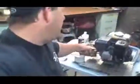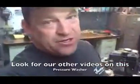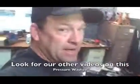Alright, so there you have it. We did a tune-up. We changed the oil on the water pump. We changed the oil on the pressure washer. Changed the spark plug. We cleaned out the throttle body and cleaned out the linkage. That's all there is to it. This took about an hour to do. Good preventive maintenance. I definitely recommend if you use a pressure washer, you do this at least minimum once a year, depending on how you use it.